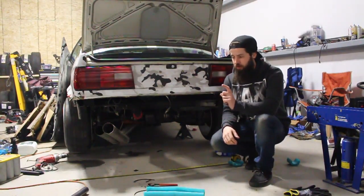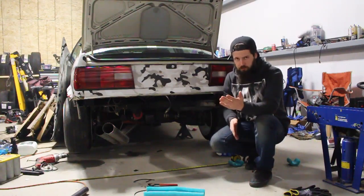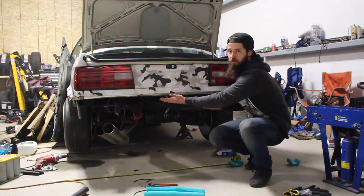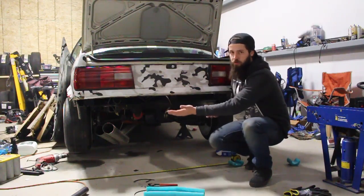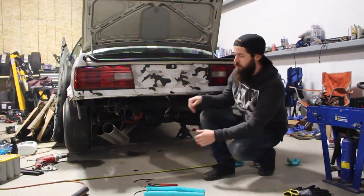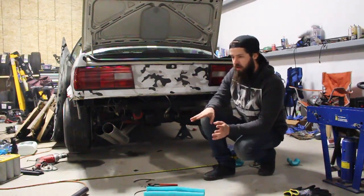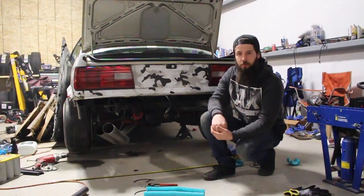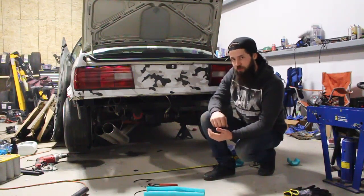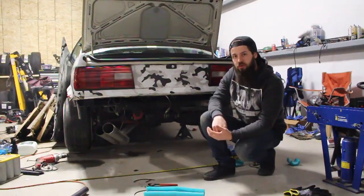I'm going to also do a reference line on the tube. It's 6 feet long, so I'll find my center point from that, mark it out, and that way I'll have something to reference off of every time I bring the tube back from the bender, and double check, make sure everything's good, and I won't lose where it's supposed to sit on the body. So we're going to do a couple marks on the tube, get that all finalized, start throwing it in the bender. We'll do a couple small test runs, make sure everything's good before we go for the full-on bend. And then I'll start mocking it up and test fit it and show you guys what it looks like.